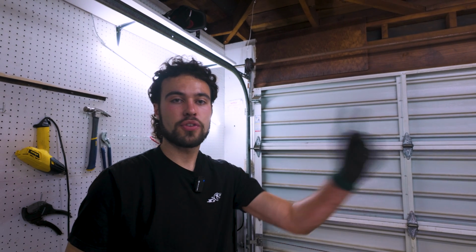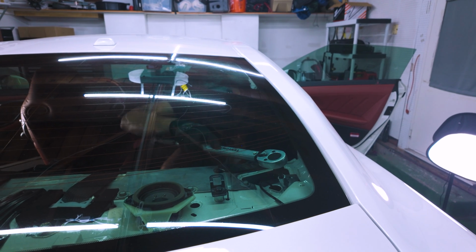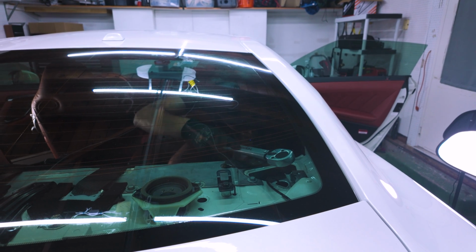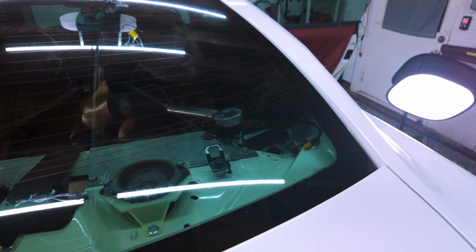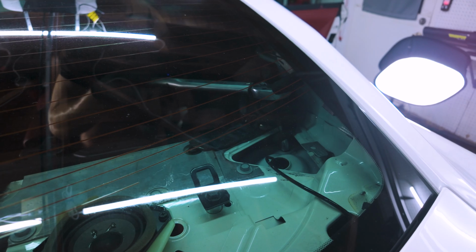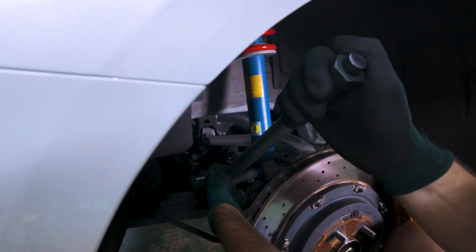It may take a little bit to get everything perfectly aligned, but just be careful, be patient, and it should be all good. Now all we have to do is torque everything down, so I'm gonna start with the 3 top bolts. The torque spec for those is 29 foot-pounds, and then that bottom bolt is going to be 55 foot-pounds. So we'll go ahead and do those now. And don't break your windshield when you do this. There's one. 29, 29. Beautiful. And we're all set in here.